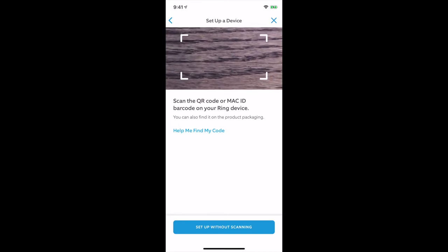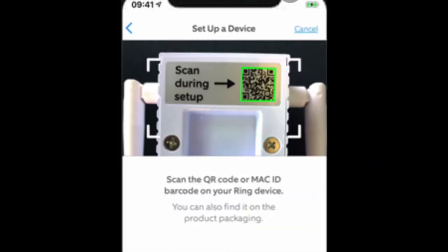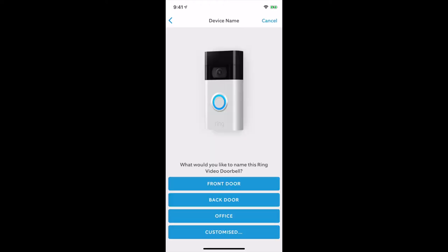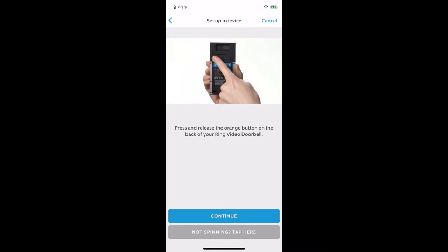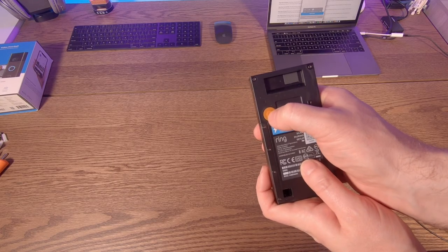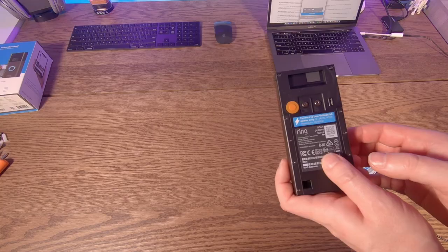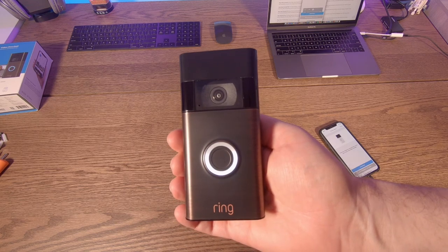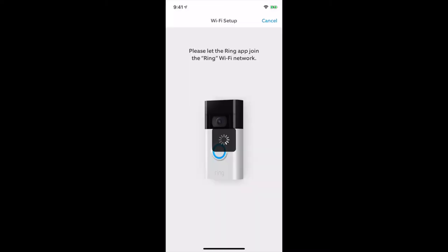This is the code that we're going to point our camera to. Once the code has been scanned, it's going to ask you to set up your location — where is this device physically located? Add a new location, and then enter the necessary information. What would you like to name this Ring Video Doorbell? It's going to be on my front door, so I'm going to select Front Door. You can make that anything you want. Press and release the orange button on the back of your Ring Doorbell. The front panel where the Ring button is will have an LED spinning around — if it's spinning, select Continue. Your device has now created a Wi-Fi network called Ring Setup 38 in my case, and your phone and the application now want to connect to it. Select Join, and the Ring application will join the Wi-Fi network created by your doorbell itself.